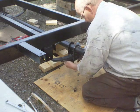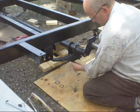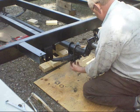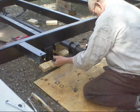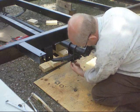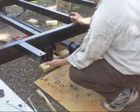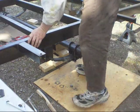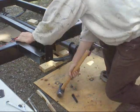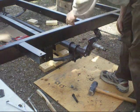According to eTrailer, these U-bolts will have to be snugged up evenly on all four sides. They say just until the plate here starts to bend a bit — that should be enough torque. They don't give an actual specification. Now hopefully I can line these holes up here. Make sure you get all your lock washers on. It was easier access from this side, so I'll put that in from there — this way the holes should line up on the other side. I should be able to just tap that in.